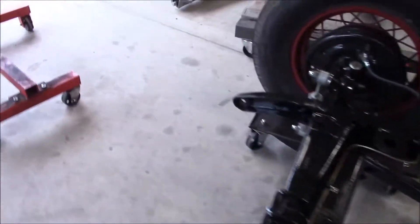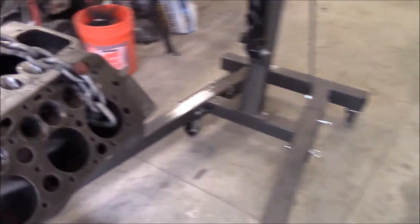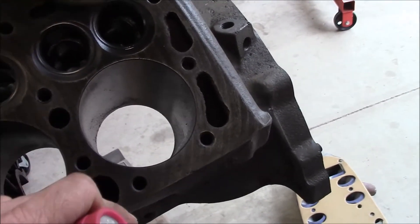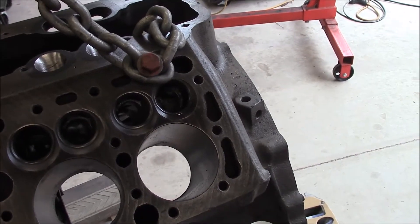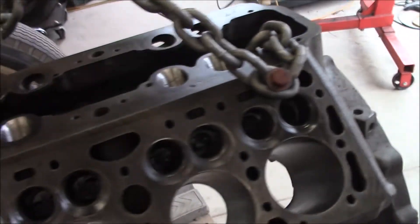That's pretty much what I've been doing — it's coming along pretty good, making progress. I did find, while looking at my motor a little closer, that number eight cylinder has pretty bad corrosion pits. I measured the depth of that corrosion and got about 52 thousandths wall thickness on that cylinder, so the machine shop is probably going to have to sleeve that one, and maybe one more cylinder. I'm hoping that's all I'll have to sleeve, but we'll see — I'll be taking it in to them tomorrow.